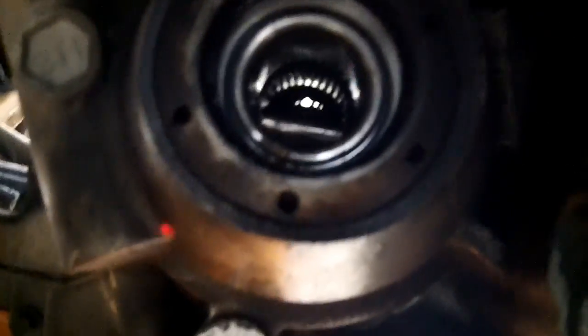There's two screws, so you can choose one or the other. There are two mounting points on the bottom for the intake manifold bracket. There's one there and one there, and you can choose either one. I would recommend this one and the one on the right side, so that makes it kind of a straight shot down there. Obviously this is your starter, and up there where you can't really see it is your starter solenoid. On top, oh, there's a good look inside the axle for you, or probably through the axle, but I can't see it because I can't lift my neck up that far.